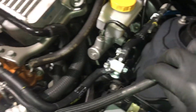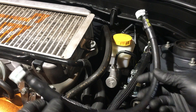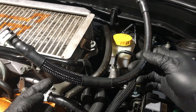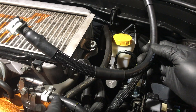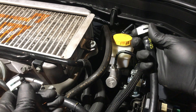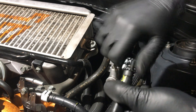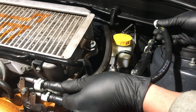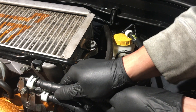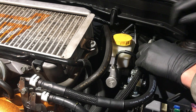We'll throw this top reference hose back on and we'll be good to go. Now it's time to install the top fuel feed — the part that has the protective sheathing on it goes towards the intake runner, and the part that doesn't goes towards the firewall. If you're having problems with these connectors where they're at, you can take them and kind of twist them to get them where you want. I wanted mine to both face the same way so it looks the same. Push it on and you'll feel it stop and click — push that down, give it a tug to make sure it's on there, and repeat for the other side.